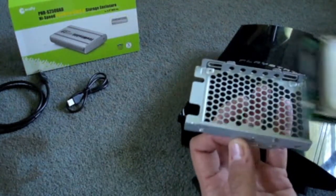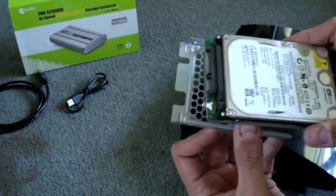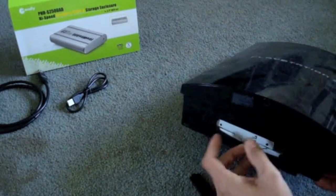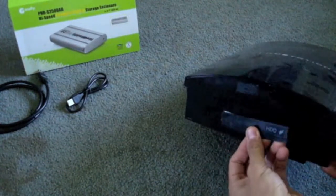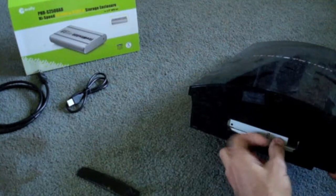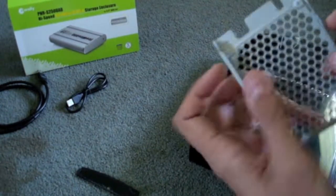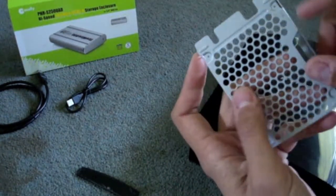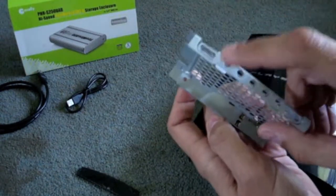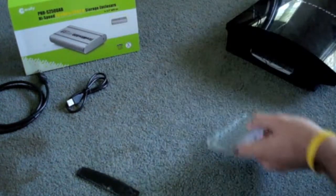This is the casing that the hard drive actually goes into. This is the hard drive here — this is the 160 gig. The hard drive sits in here, in this little cage, and goes into the PlayStation. You take this little door out — this is the older models, so it's a little different for everybody with the new ones. You take this door off, pull out the little handle, and then there will be screws in four different locations along the side so you can get it out — one, two, three, and four — and then the hard drive becomes free. The hard drive will come out of the cage, and then really you don't need the PlayStation anymore.